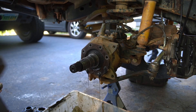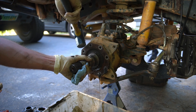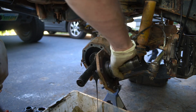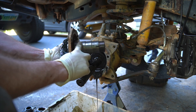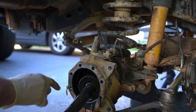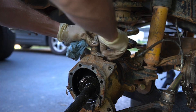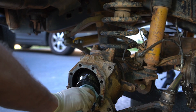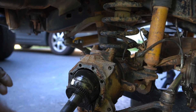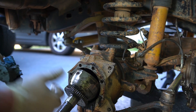Next we're going to pull this flange and the whole snout that goes over the axle. If it doesn't want to break free, give it a few light taps of a hammer right here. That pops off — more fluid pouring out. Set it to the side and inspect all your surfaces to make sure nothing's eaten up from previous bearing failures. This is the ABS model, so we have to remove the ABS sensor before we can remove the axle itself — it's just a 12mm bolt. For a non-ABS, you don't have to worry about this. Now wipe down the axle. There are two flat spots on the rear birfield joint — the axle won't come out unless it's aligned with the flat spots in the knuckle.